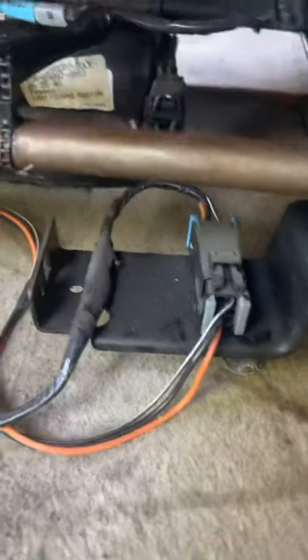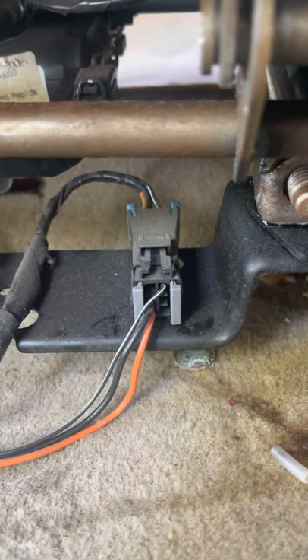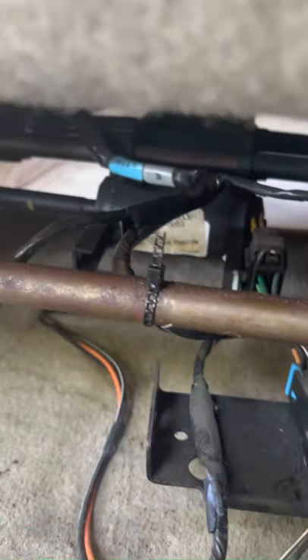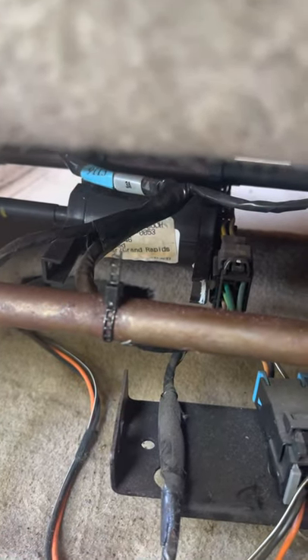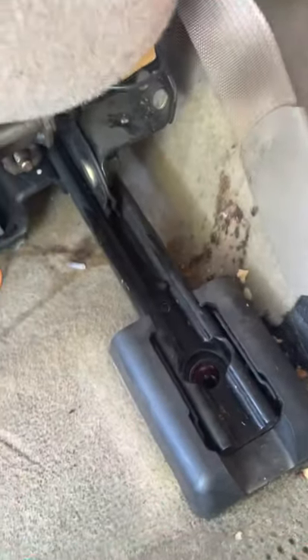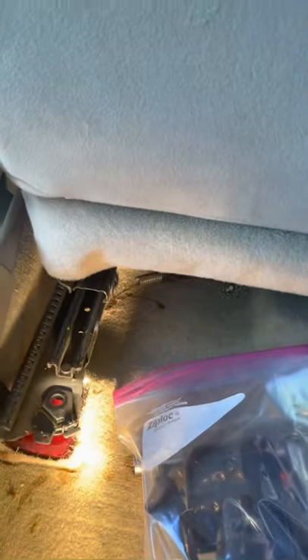This is the electric seat, so you can see you have a metal plastic clip here. You're going to have to take this off — this part goes into the bottom and this other part goes up into the top. You want to disconnect this connector, but don't disconnect it until you're done getting all the parts out. These plastic clips don't remove separately — they come off with the seat. Unlike some cars, when this back comes off, the front part is easy to remove.